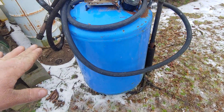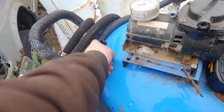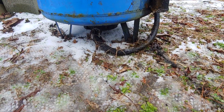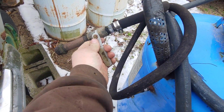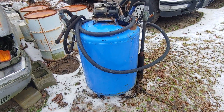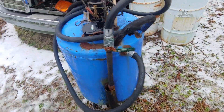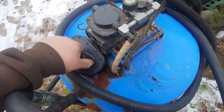After it was full, I would pressurize it here with a compressor on the bladder tank valve that's already in there — you don't even have to put one in, it's already there. And then I would discharge it out of this hose at the bottom of the tank, which is the normal connection point for the well. I would put this into a jug and then open it up and it would pressurize out through the tank. This is probably the best way to do it, because having an actual pump do this job is too much — putting that oil through the impeller and all that, it's never really going to work right. Not on a tool battery with low power input, not having 110.